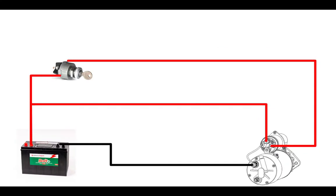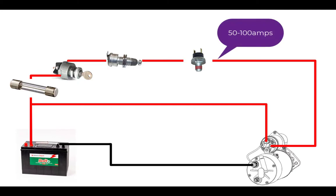With this we can get a little fancier — we could put in a clutch disconnect switch or a neutral safety switch. We could possibly put in a pressure switch hooked to the engine oil so that if we have engine oil pressure the starter can't operate. This wire may be running all over the cab into the engine bay down to the starter, so we may want to put a fuse in that system. Our control circuit is only running the amperage required to fire or engage the pull-in and hold-in windings of the starter solenoid — if we measured those windings it would probably be somewhere between 50 and 100 amps.